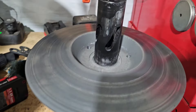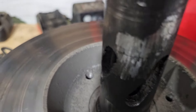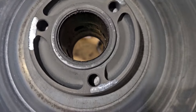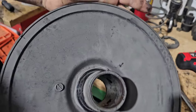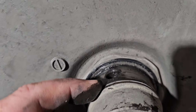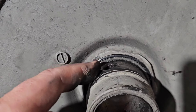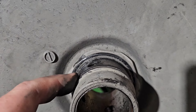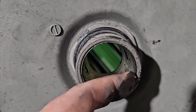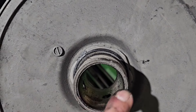Pull that off nice and easy — that's where the pins go. Now here's what the inside looks like; you can see all the buildup and grime. There's an o-ring here and an o-ring at the bottom — take a little pick and pull those o-rings out. You don't want brake clean sprayed directly on them; it won't kill them but it's not ideal. Same deal with your seals in here — just wipe them off really well.